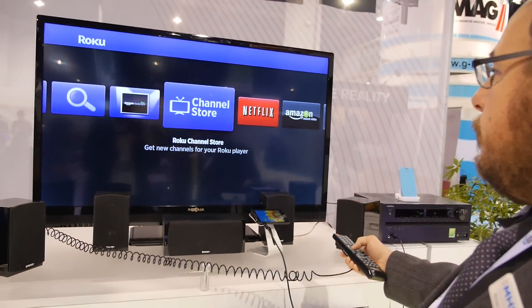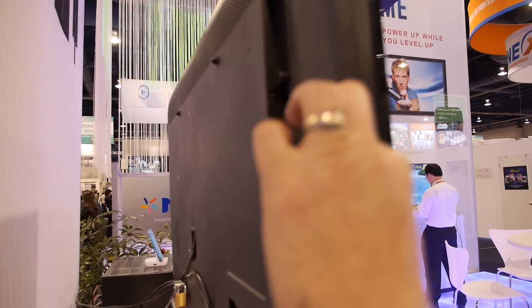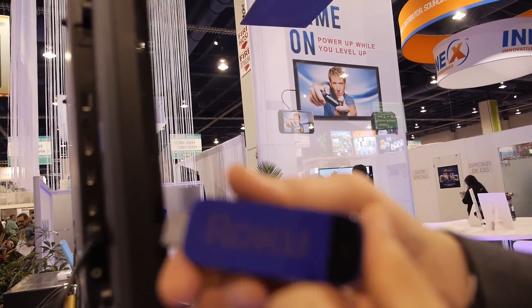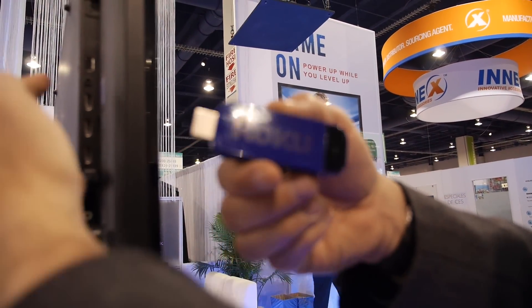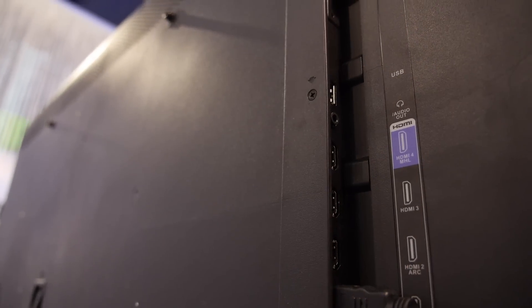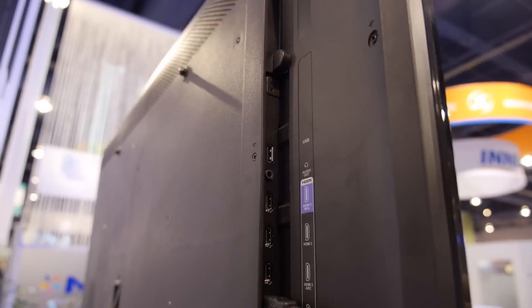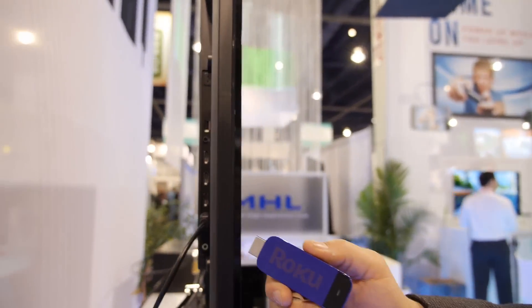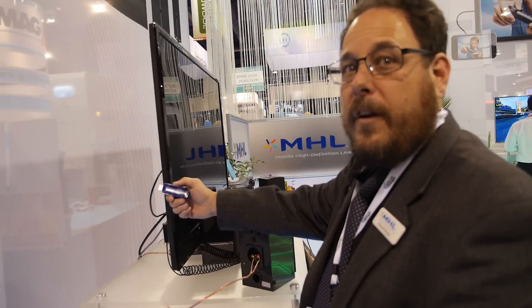Come around the back of the TV. This is the Roku streaming stick — and it's powered by MHL. If you look at the port, the port even says it in purple, just like the stick: MHL slash HDMI. The MHL port actually powers the Roku stick, and the remote control protocol part of MHL allows the TV's remote to let you change the station, change the channel, select your videos, search for different content, etc.